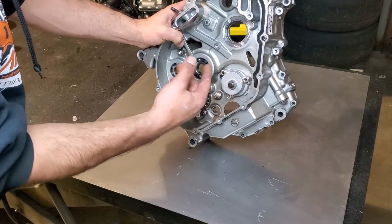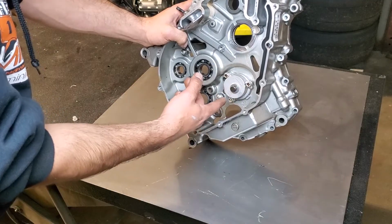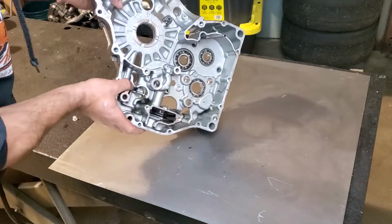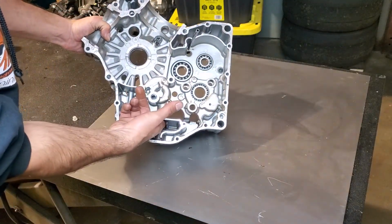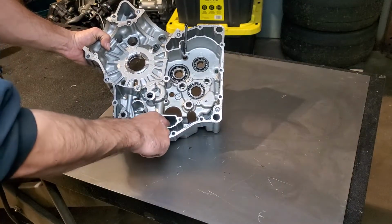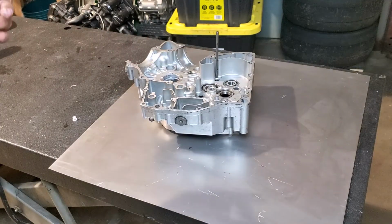In my previous attempt, I had made the assumption that the pump needed to be in the oil to pump. Somebody corrected me and said that the actual tube going to the pump needs to be in oil, and if the bottom of it is in oil, the pump will still pump. So we need to get this area out of the oil, and I spent the last couple of days trying to figure out how to demo that using plexiglass and sealant and all that stuff, and I'm going to show you that in a second.